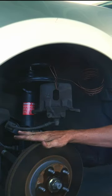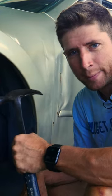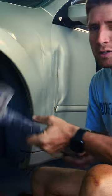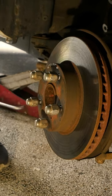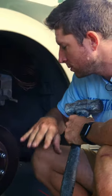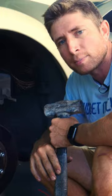There are a few methods I use to get a stuck rotor off. The most common and most effective I've found is with a hammer — not a small hammer, you need something like a sledgehammer. Don't be surprised if you've got to hit it like 20 times. I've had some that I thought were impossible, but I just kept on hitting it and eventually it pops loose.